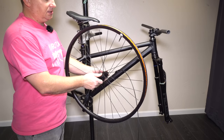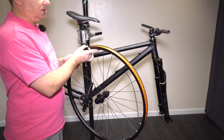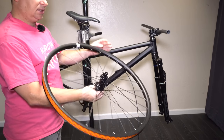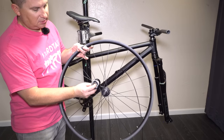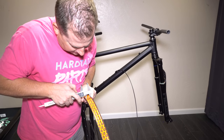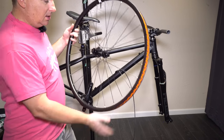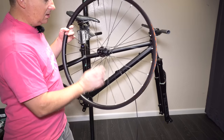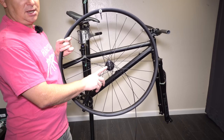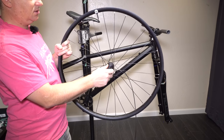The BC Lomer wheel set isn't super high engagement — this is meant to be a budget wheel set to get you going and something you can upgrade later. It's center lock only, so I'll be running some DT Swiss center lock to six-bolt adapters. The inner width of the rim is 27.5mm, so it's a slightly narrower rim. You can swap the drivers out and order it in HG, XD, or Microspline — I like HG because that's what the MicroShift Advent X runs, which is what I use on almost every one of my bikes.